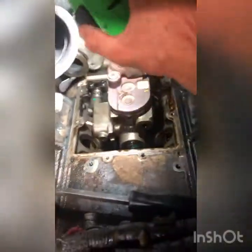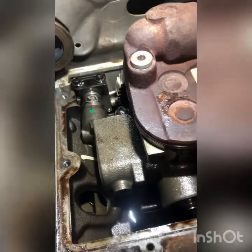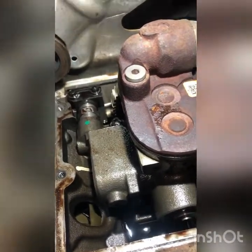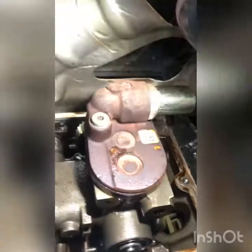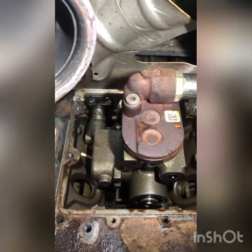So we're going to remove that pump and replace that fitting. This has the older style fitting on it — there have been some updates. If you've got an older truck that's never been apart, most likely it has this old fitting, which will leak at some point. You're going to have to disassemble all this, get down to that pump, and install the updated fitting.